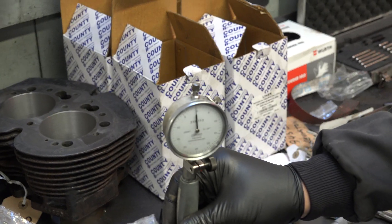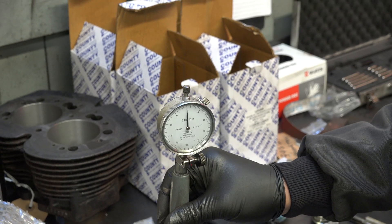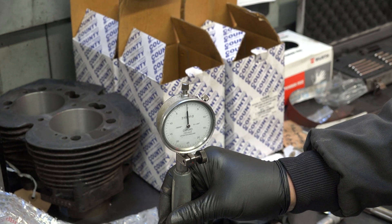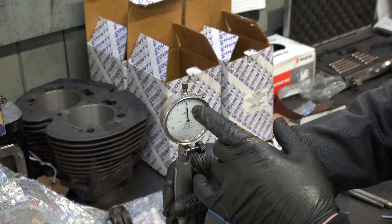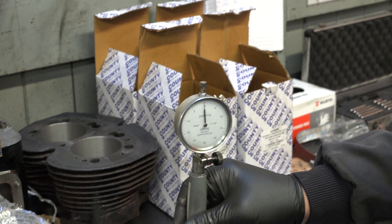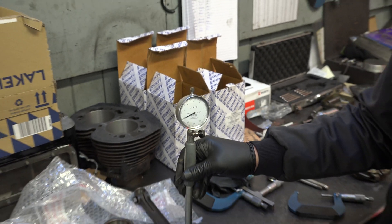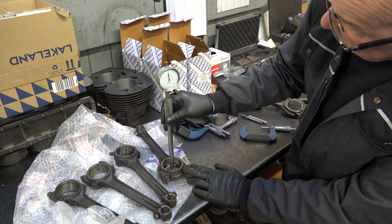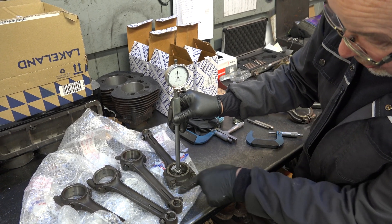You can see it's almost on zero — each line is half a thousandth of an inch. That means that diameter is set up to what the gauge says. That's good — that's the right side. But you've got a spinner that is actually almost half a thousandth of an inch over that size, though there'll be a tolerance allowance for that anyway. Then you check it top and bottom because sometimes they can be bigger one end than the other.